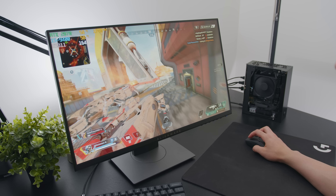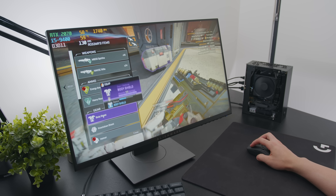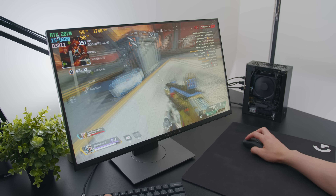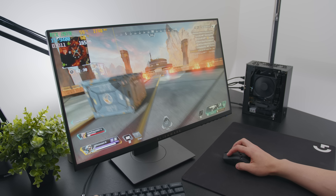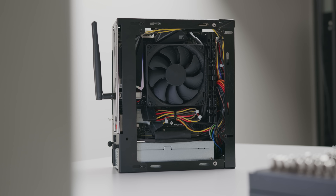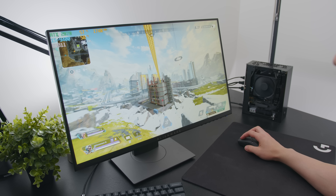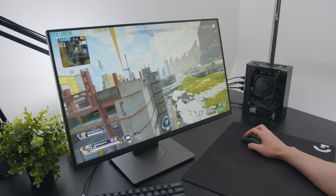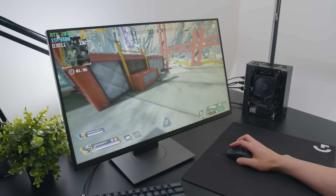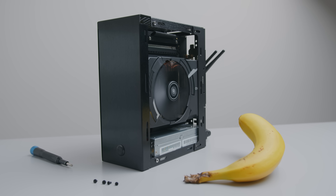The results with the HDPlex setup were just fine — no issues at full load, no noise whatsoever. The power supply runs perfectly fine with the i5-9400 and RTX 2070, and undervolting the GPU helps bring power consumption down further, though it was fine at stock too. The silent power supply setup here is a decent bit quieter than even the Noctua-modded flex ATX unit. In my opinion, this would be the preferred setup for a build that will mostly stay on your desk, since you can easily hide the power brick out of sight.